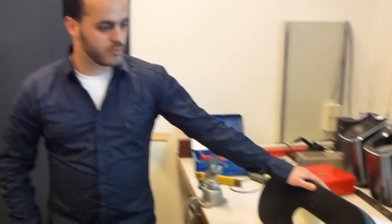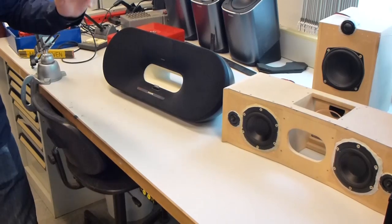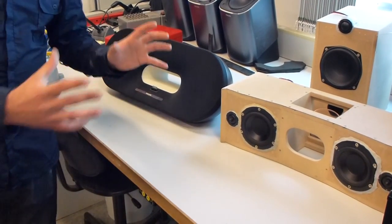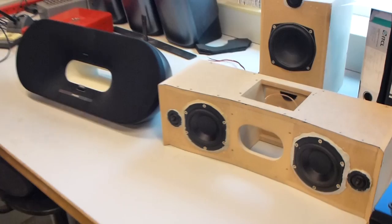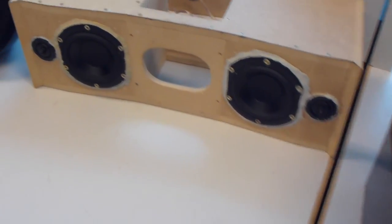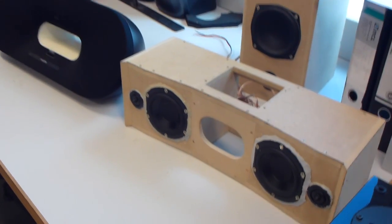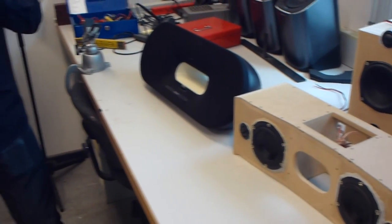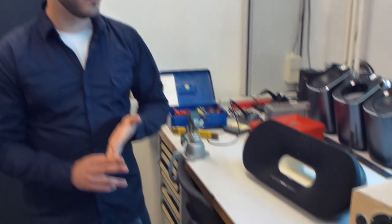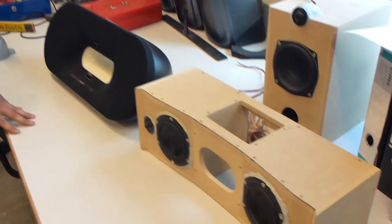It's literally two small speakers in one shape — like a small micro system. We stayed with very high quality drivers and very high quality electronics. In the prototype we tested the high quality tweeter and woofer, and the acoustic volume behind the woofer is chosen very specifically to get the correct bass response.